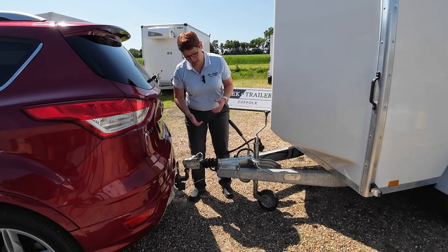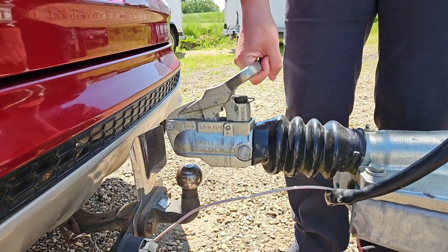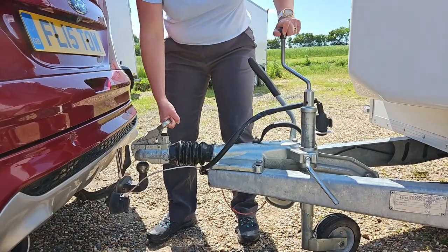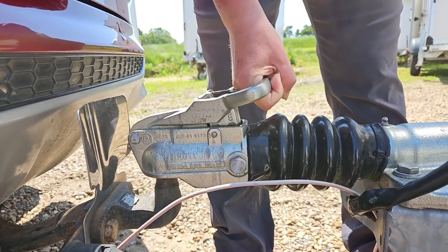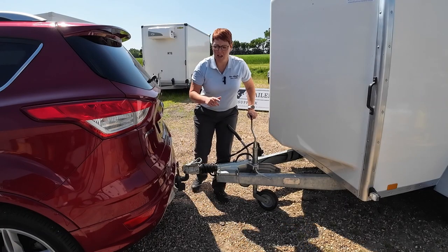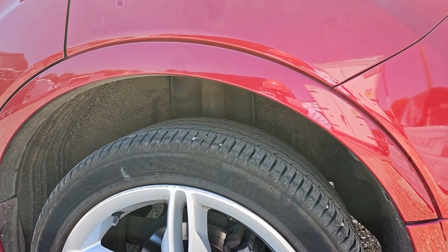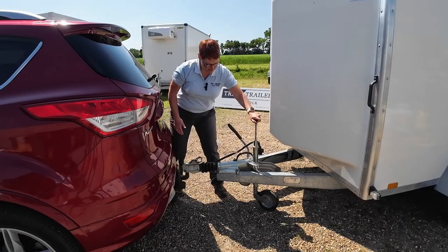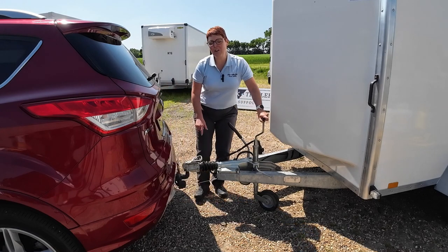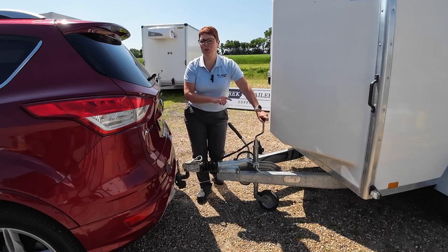To actually hitch this on, you have to move the lock out of the way and raise the handle. We now use the jockey wheel handle to lower the hitch onto the tow ball. But we don't trust that — so what we do is rewind the jockey wheel so that it raises the back of the car. If you're on your own doing this, just put your leg against the car, and as you wind the jockey wheel you'll feel the car raising against your leg. That confirms that this is coupled and that the hitch and tow ball are not becoming detached.